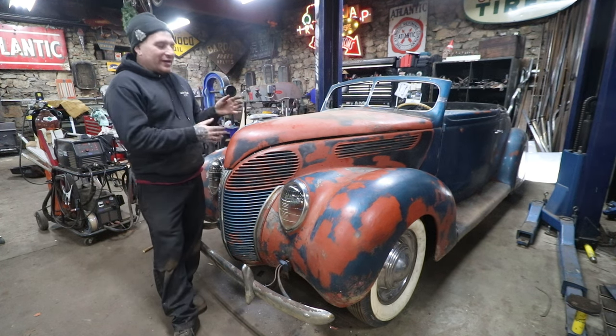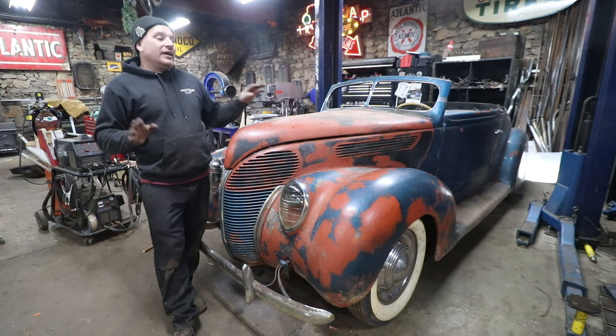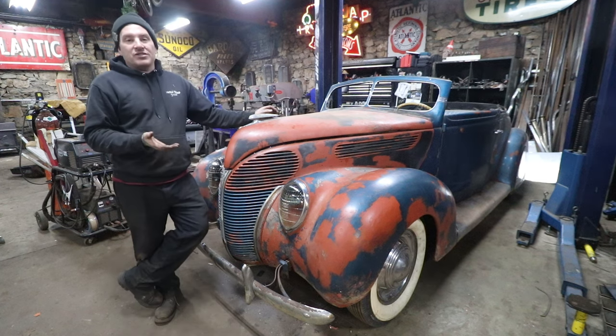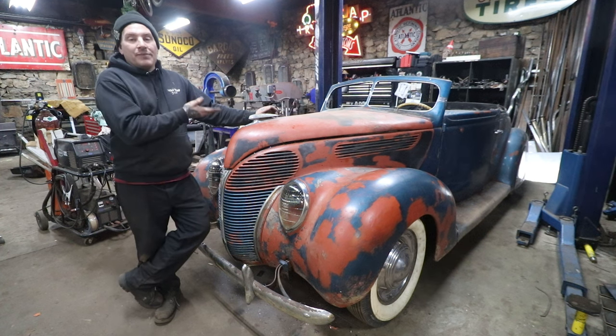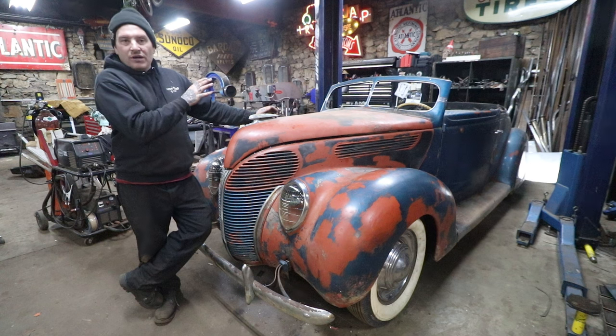And that didn't really translate once I put it on the hood and moved everything around where it wanted to be. We latched the hood and I had a crazy gap on the side here, and I ended up having to basically tunnel or French or recess, for lack of a better term, the top latch piece up into the hood, something like an inch and a quarter roughly.